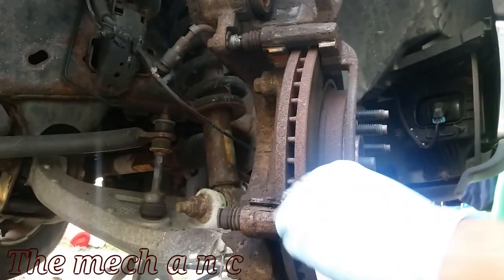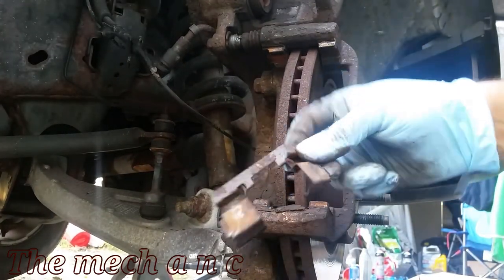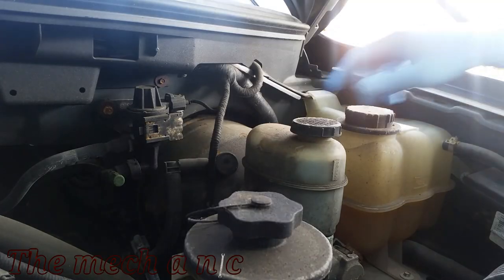So when you go out to buy brake pads, I know they sell like an economy set. Basically, it's just the brake pads. They're not going to give you any of the shims or the hardware kit, and you're definitely going to have to go out and buy the hardware kit separately. But I just recommend getting the mid-grade brake pads. They usually tend to come with the hardware kit, so you wouldn't have to worry about it at that point.